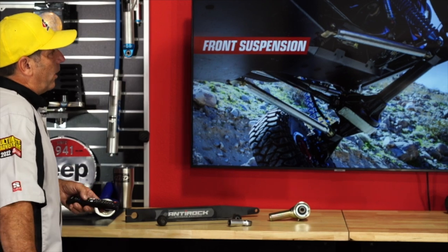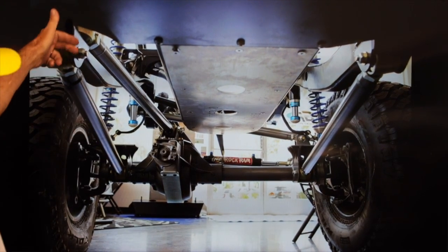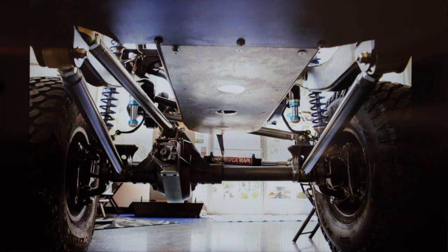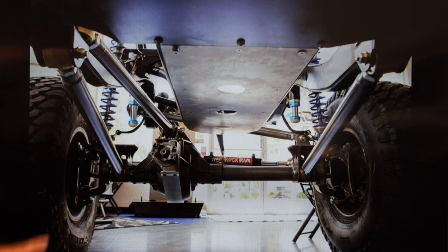Here's another view — it's a little hard to see with the drive shaft in because the upper link and the drive shaft run parallel. You can see the three links plus the track bar, and that's how the front suspension works so well — it's bind-free. This is considered a long-arm setup. All the brackets are heavy duty; this one has built-in landing pads. What we're looking at is one of our Legend suspensions, but it's exactly the same on the Tracer, Elite, and EXS.